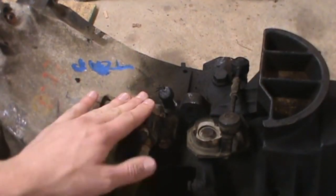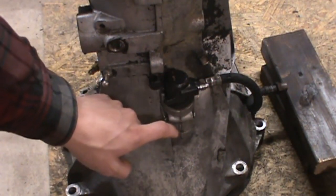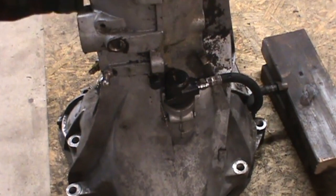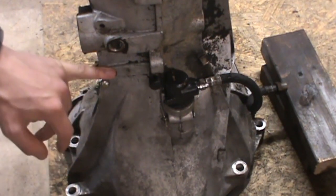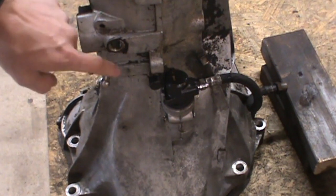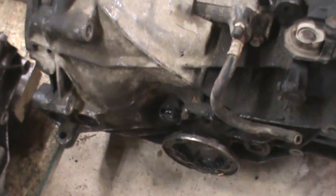The slave cylinder on the 200's 016 transmission is held in by a bolt, but on the 4000's 016 bell housing it's held in by a pin up here — that's one of the major differences. If you're going to be swapping these transmissions, I would recommend keeping your 4000 bell housing. What I'm doing is just swapping the gear carrier into that bell housing. Another difference is the pin for the shift stabilizing linkage: on the 4000 it uses the hole up front, but on the 200 it uses the hole in the back, so you'll need to move that.